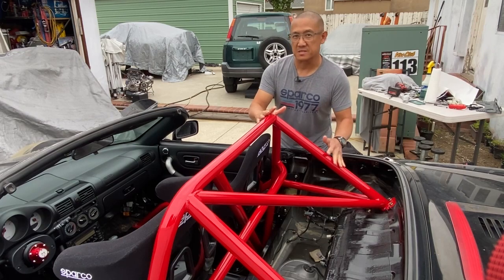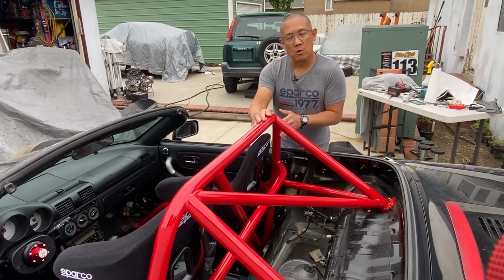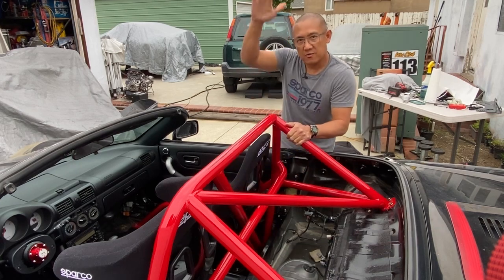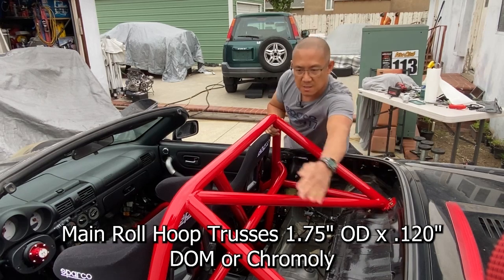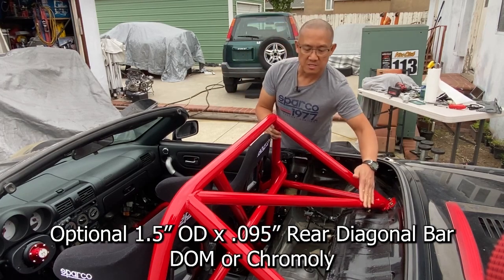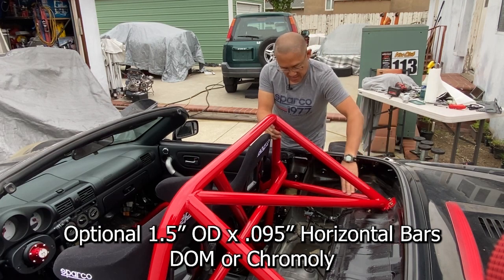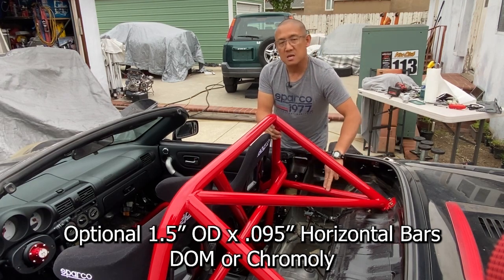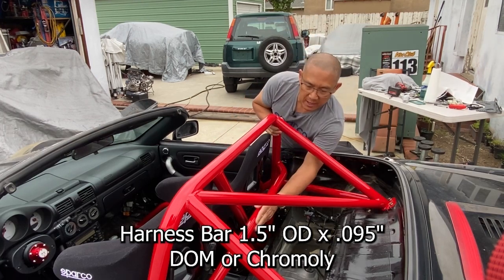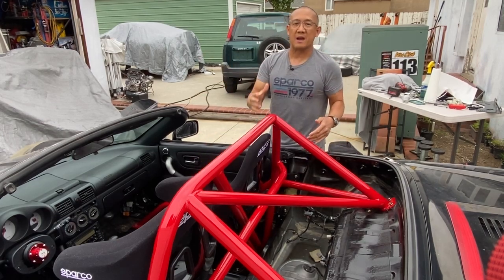Let's talk more in depth about the design of this half cage. The main roll hoop is a little more vertical than what you would normally see — the more vertical the main roll hoop is, the better for rollover protection. We added a diagonal underneath the main roll hoop, which is great for rollover as well. The trusses in the back stop the main roll hoop from flexing side to side. The rear diagonal provides additional protection. The horizontal bars in this section add torsional rigidity via the door bars. This last bar is for your shoulder straps, and it's bent to allow the driver's seat to go further back for tall people.